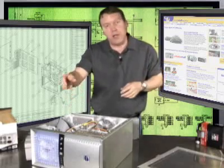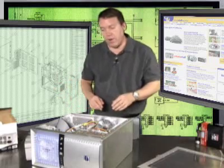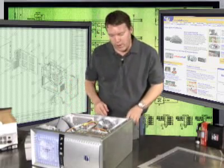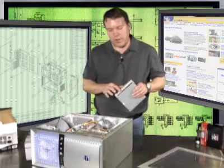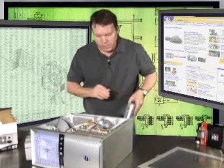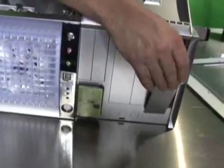With the cable in place, power in place, the jumper set properly, and the screws in place, that drive is secure and ready to go. We're going to do the same thing with the CD drive. We've already set the jumper. It's going to fit in the front of the case and we're going to pop out one of these faceplates to make room for it.